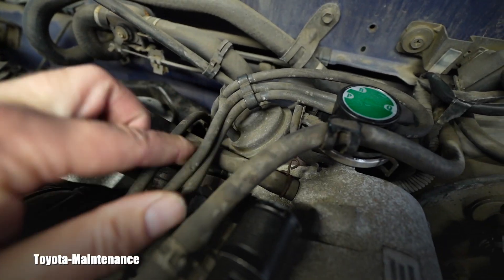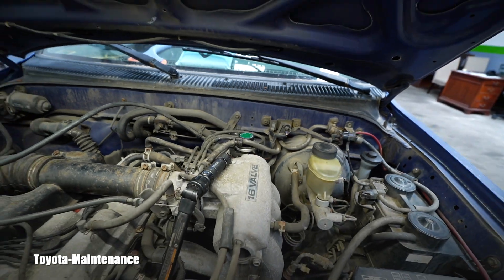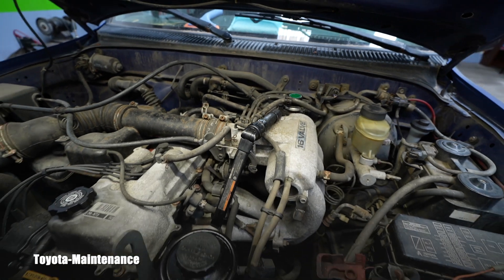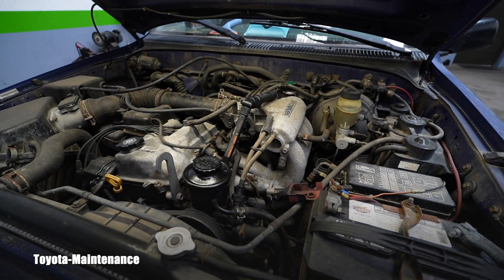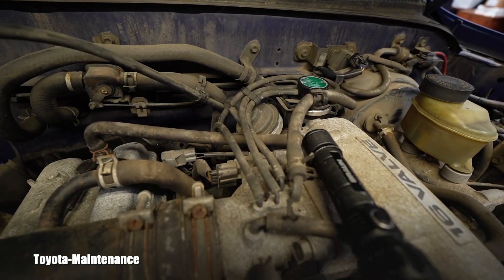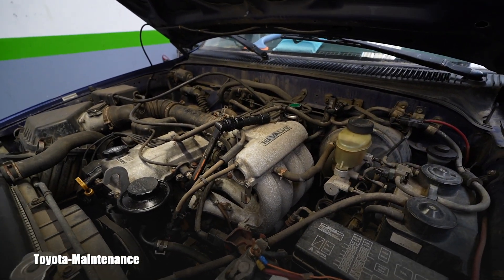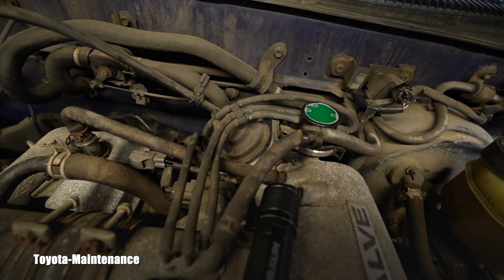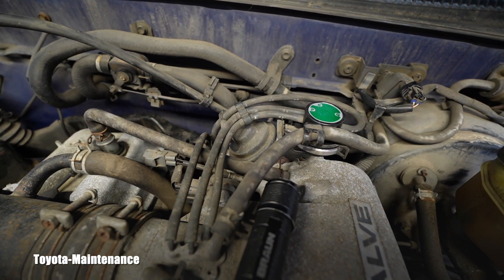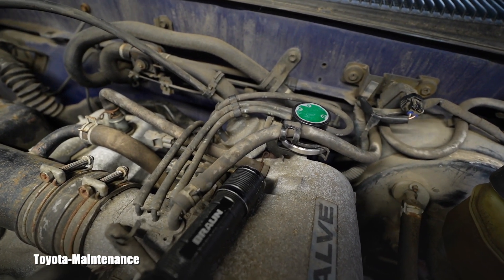The code basically says the EGR is sending too much exhaust gases into the intake. So I immediately disconnected this line, started up the engine, and applied vacuum to it. Because it was idling and cold, the engine immediately started struggling to run and died — because that EGR is not supposed to be open at these conditions.